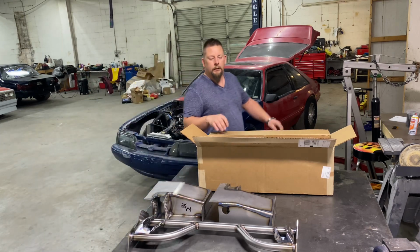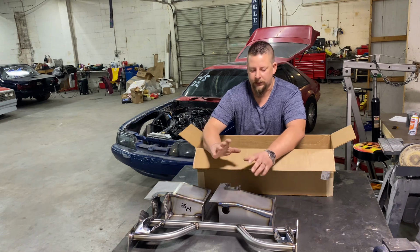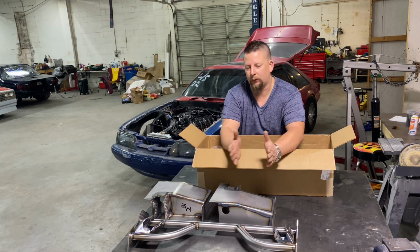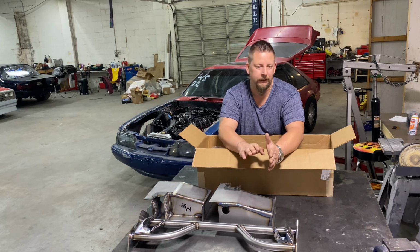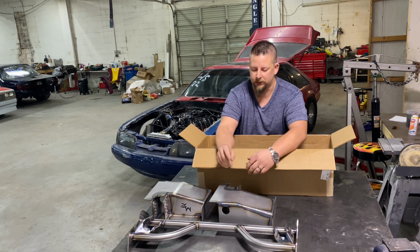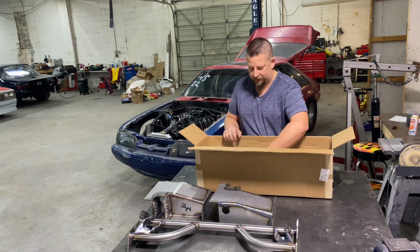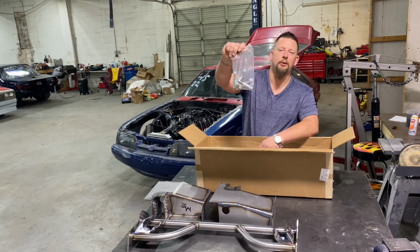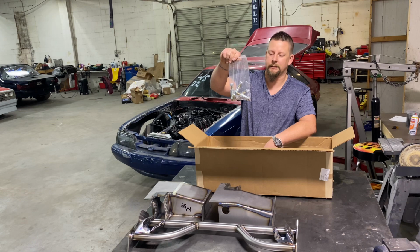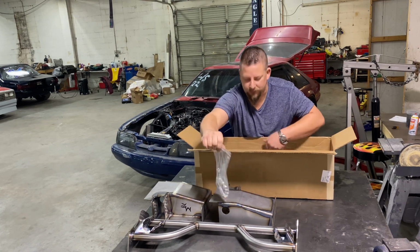But Marty takes his torque boxes and closes them up just a little bit, which adds some strength to everything in the car. Anytime you have it wider, of course, you have a longer bolt, and then you have to worry about bolt flex and the way it's pushing on the torque box and all that stuff. So Marty closes them up just a touch, but because he does, he sends you new bolts and heim joint alignment pieces. So yeah, that makes things a lot easier.